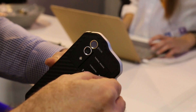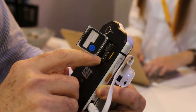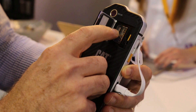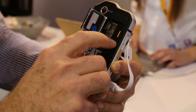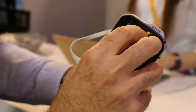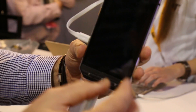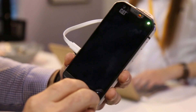How do we achieve that? We have a special sealing for two nano-SIM slots, and this sealing makes sure no water comes in. We also have a micro SD slot for 128 gigabytes on top — this is a prototype, so we'll have a manual lock later to avoid accidentally opening it. If you go below two meters, there is a mechanical closure so we can close the speaker and microphone with these switches to make sure no water comes in, because these two points are the weakest points when it comes to water.